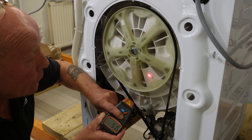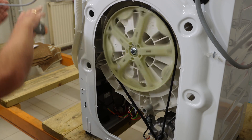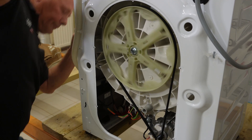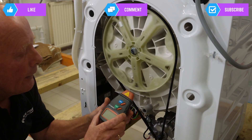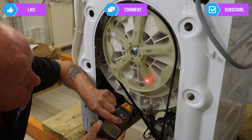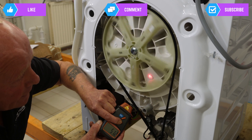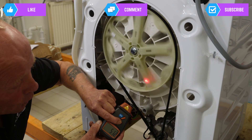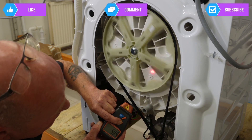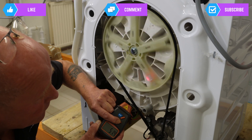Although you're seeing the wheel turn anti-clockwise here, I'll change it over to the other direction. Pointing it at the mark again — and this is why I put the marker at a clear point on the pulley wheel — we have a reading of 51.4 to 51.6 RPM. That's all perfectly correct.